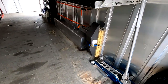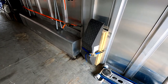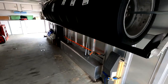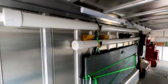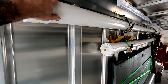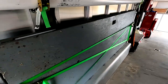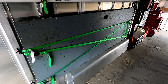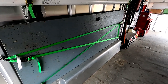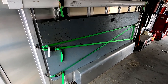I have a nice jack for at the track. This is a little ramp that I use — if you get a flat and you have a dual-axle trailer, you can simply pull that up onto the tire next to it and very easily change tires. That's a little trick I've come up with. I've got a nice tire rack with all my tires. All of my canopy poles are nested inside big pieces of PVC with caps on them. I also have two big pieces of plywood plus a little one that goes in between. A lot of times as club racers we park in the grass, and jacking up your car in the grass is a real pain and can be very dangerous. This plywood is big enough so I can pull my car on there and put the jack and jack stands on it, so it's very safe.